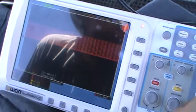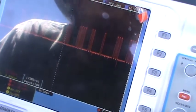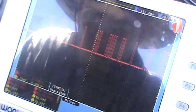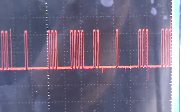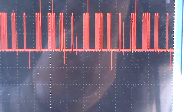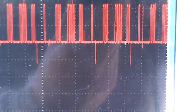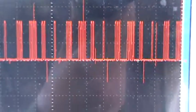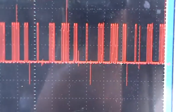We want to see a little more detail — we can pause it and zoom in. This is an 04 Nissan Sentra, and this is what the camshaft position sensor signal looks like. We were correct — that's the signal wire. This would be a pull-up design, meaning the sensor itself produces the waveform — it produces square waves and sends them to the computer. Pull-up design.